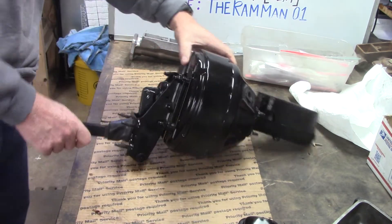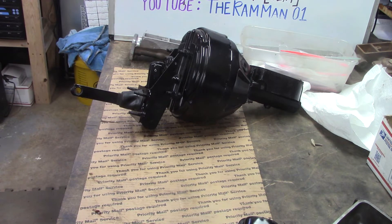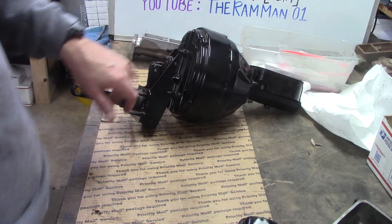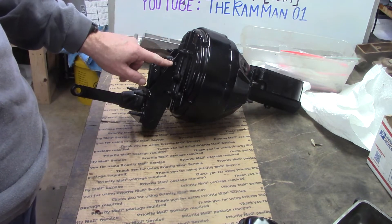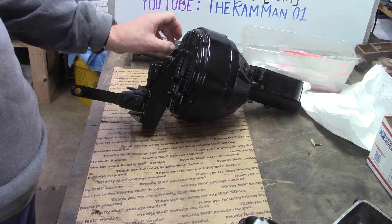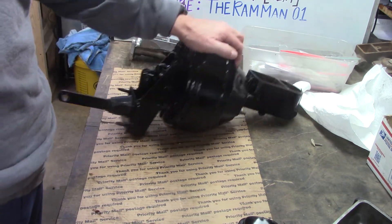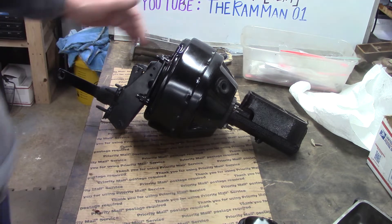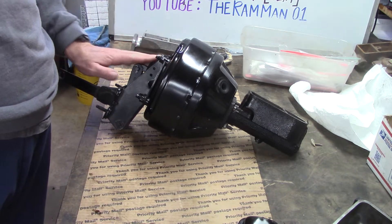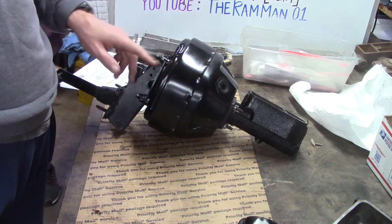Moving over to the back of the booster and the bracket assembly. As you can see, back here on the back of the booster we've got a set of brackets bolted up. The Hemi booster has large three-eighths studs instead of five-sixteenths. There are quarter-inch spacers between the brackets and the booster that sets it off to get the correct geometry. Right here on the back of the booster is the boot retainer plate.